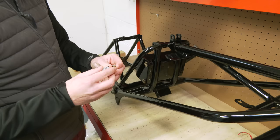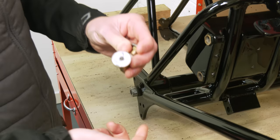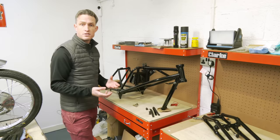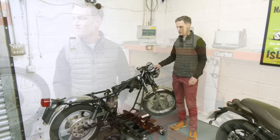We've also cleaned up the oil tap. This is quite interesting because it's got a dial on it, so you can change the feed rate. It's not a total loss system so it will recirculate, but this helps control that — you can turn it down to zero and it will stop the oil flowing and prevent wet sumping. A nice period tap. Lots to do, but hopefully next time in the next video log we'll have part of the bottom end of the engine back, which is having new bush bearings fitted. That should be on the bench next time.